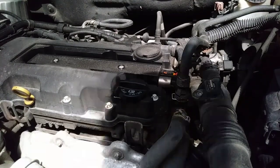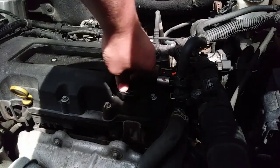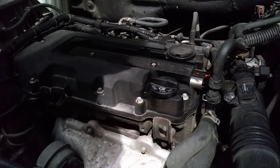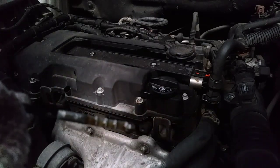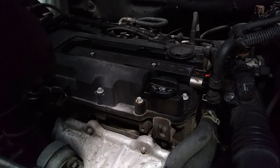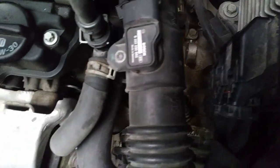All right, I'm going to fire it up real quick and check the oil. I poured in about four and a half quarts — I believe that's what it takes. We'll check it with the dipstick. It's about where we want it. Now you're going to want to double-check for oil leaks, especially down by the canister — make sure the o-ring is not leaking out. Looks like we're good.